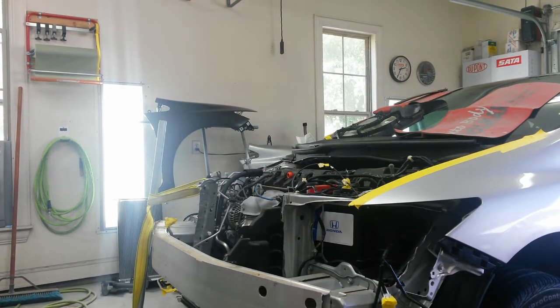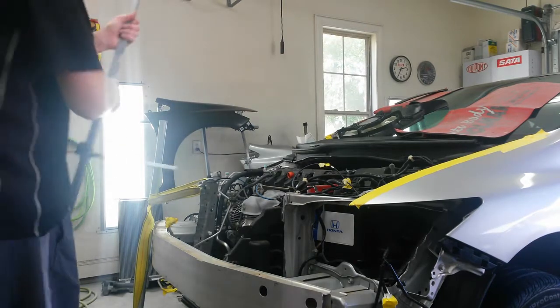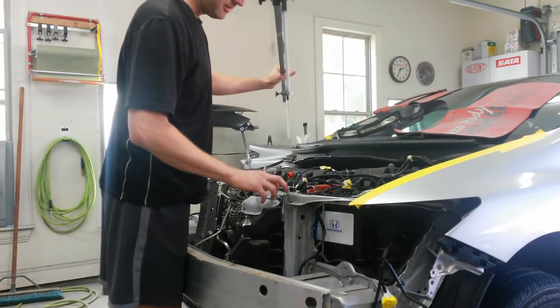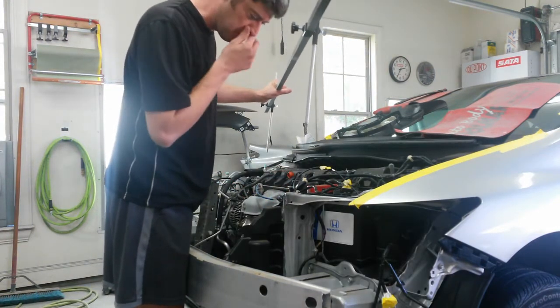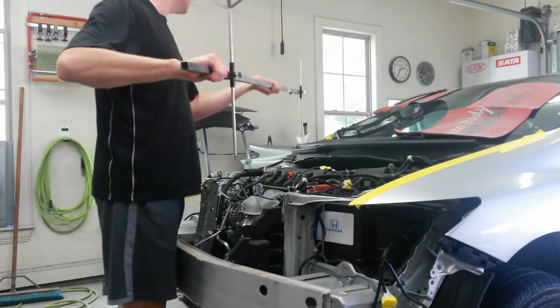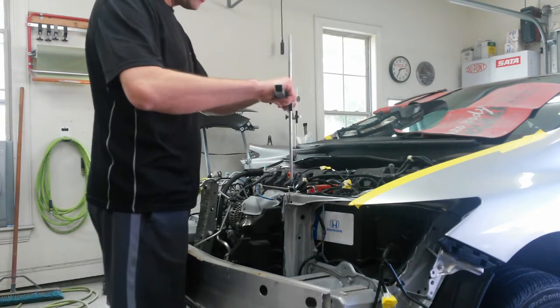Alright, I've got the strap and the pry bar set up on the rebar there. I'm gonna set the tram gauge on this side. We're gonna have to assume for right now, until I get the tie bar in, that this is in the right position. It may be a little bit further back than it needs to be, but at least get this matched to this diagonally. And I can move both of them out later if I need to.